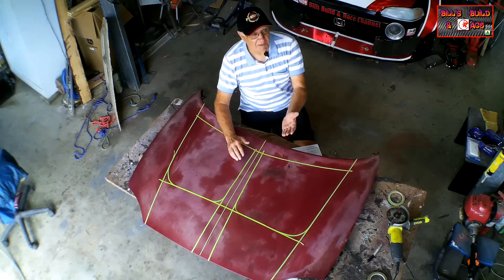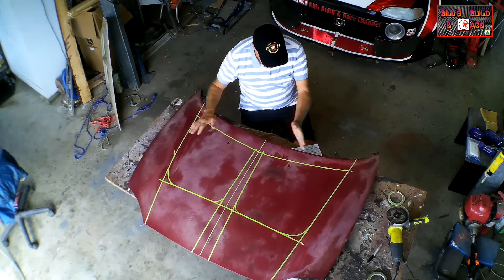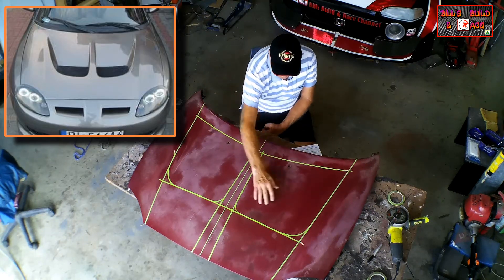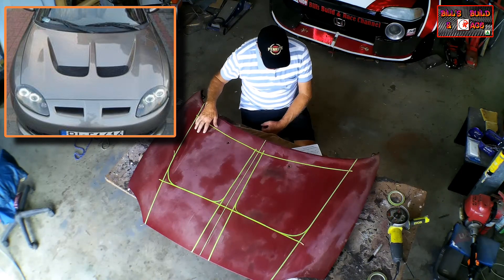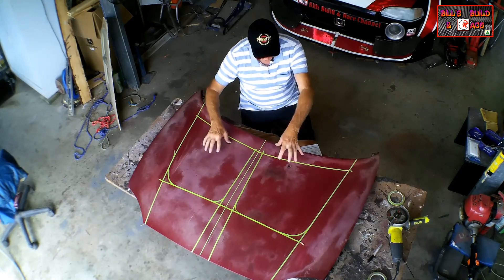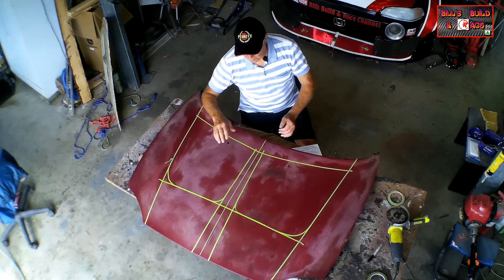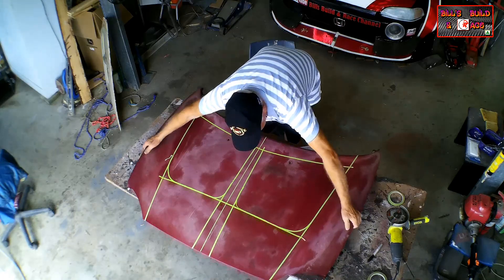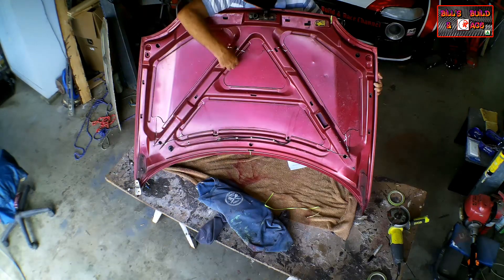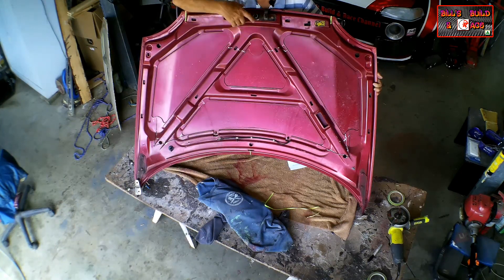This gives me the chance to show you how to make a vented bonnet for any car that you might be racing using basically stuff you've already probably got in your shed. After viewing several UK designs we selected one. I've roughed it out here on the client's spare bonnet as if I'm going to do it by cutting the steel and shaping it, turning this into a die. Mapping this out on the top showed me where I need to trim the bonnet frame away underneath — I don't need to take the whole thing out, but I know now which portion to take out, so that's where I'll start.